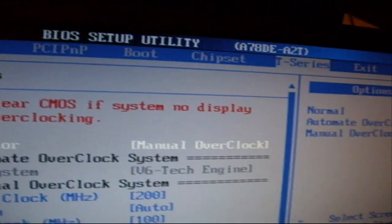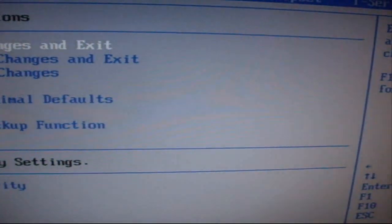The last thing you need to do is set your USB drive as the first boot device. All BIOS interfaces are different so enter your BIOS and see how it's done. Once that's set, restart the computer and the system should automatically boot from your USB drive.